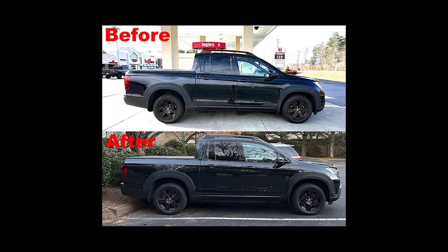Adjust your headlamps when you do this — with any lift you have to adjust your headlamps or you'll be shining into people's faces. The Ridgeline was designed to be nose-down, so when you put the lift on it's going to raise the front and shine your headlights up. Make sure your low beams are adjusted. You can do it yourself or have it done at the dealer next time you're there.